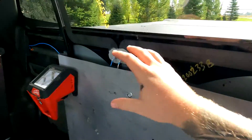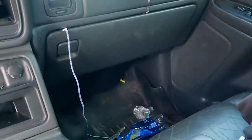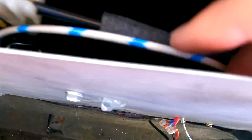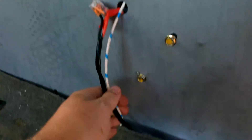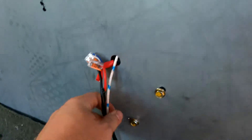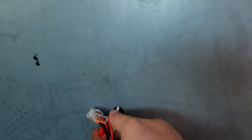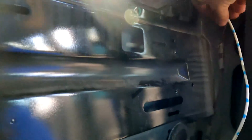I can test this before doing anything else. There's a bee in my truck — get out of here! As you can see down there, I have plenty of slack on that wire. It's not going to get cut or shorted out — it's in a nice location. Now I'm putting the window back up and I'm going to tape this wire to the bundle I already have run through here so it looks cleaner. I'm going to put duct seal in here so these wires aren't touching bare metal.